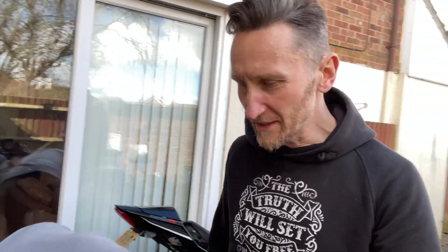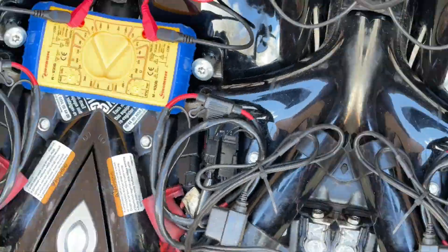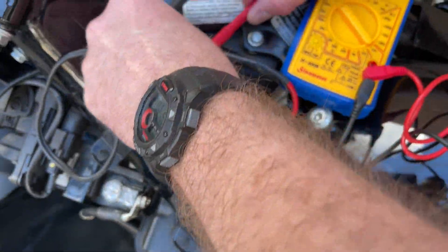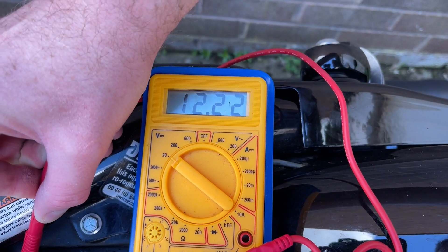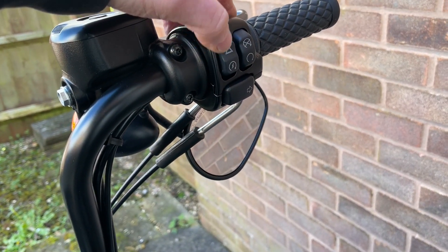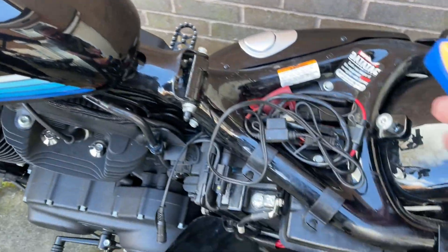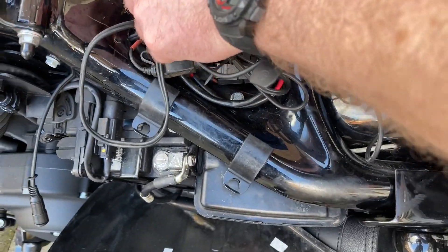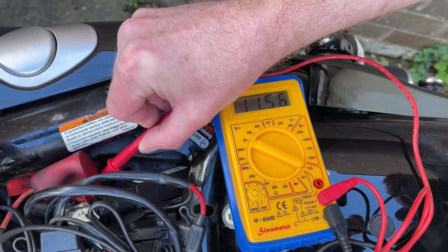You can take this in your bag — if your battery or your mate's battery fails you, you can start your bike. So we're going to connect the NOCO Genius now. We've just checked the battery voltage and it says 12.22 volts. Now let's see — the bike won't start. I'm going to check the voltage when you try to start it. It's going down — 11.50 volts.